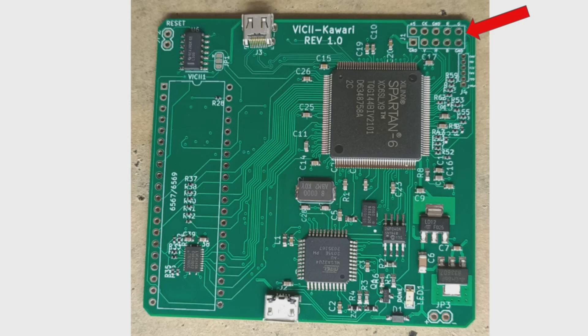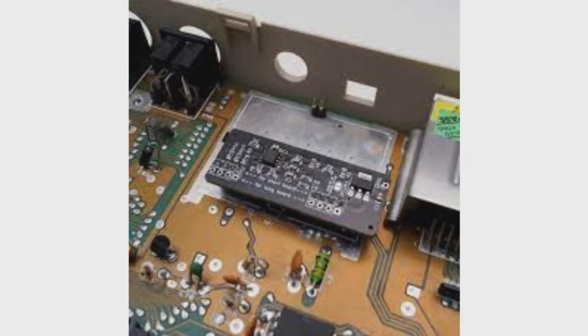The main difficulty when using HDMI or VGA is figuring out how to get the cable out of a closed machine safely — there needs to be some sort of strain relief. Having a cable plugged directly into something socketed without strain relief as it exits the machine is a disaster waiting to happen. One possibility is to remove the RF modulator and replace it with an RF replacement board, which leaves the holes at the back free. A micro HDMI cable will fit through that hole. You can also use a short shielded cable and make your own VGA plug with a 90-degree female header, but you really need to think about strain relief.